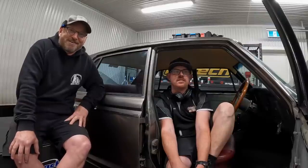So, rev limiter and then a throttle restriction. Rev limiters aren't really nice on the engine, so I'd be much happier to just do a throttle limit. A throttle limit is much softer. It's essentially just programming into the ECU backing off the throttle with a safe margin on the fuel system. Cutting the engine with the limiter is a bit nasty on it, you know what I mean?